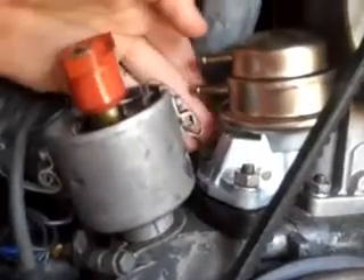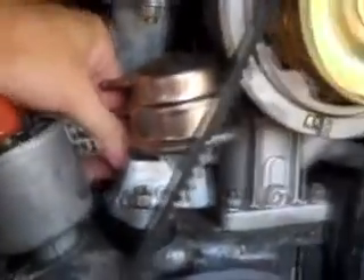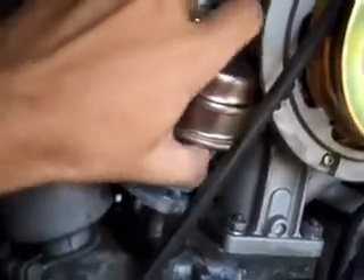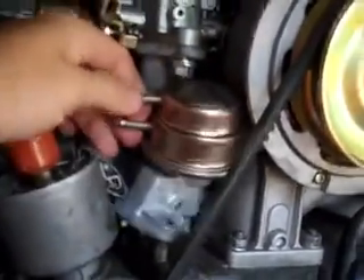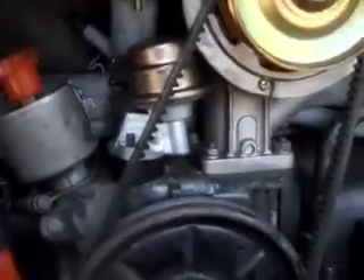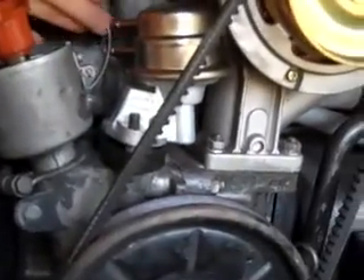To get to the back bolt there, I took off the distributor cap. Previously, we had taken off the nut here and loosened one back there, and had to lift the whole carburetor up to pull it out. Let's see how this works without the distributor cap. I need it to be the right fuel pump — it's just a matter of whether it's still functioning, because when it's cranked and the bus is running, I'm not getting any suction out of it either.